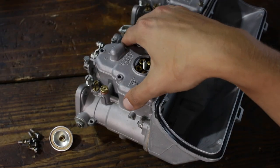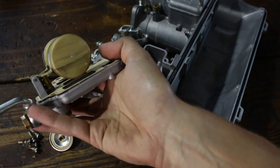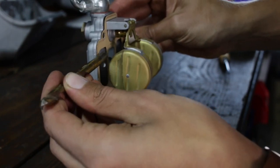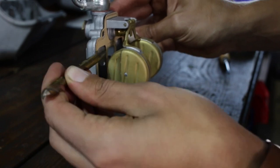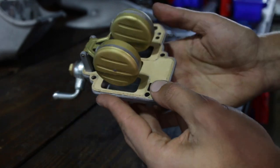The floats on the Duetto are great, but if they're not, the way to move the float level is by adjusting the brass floats within the carburetor. The standard setting for brass floats on Alfa 105s is 8.5mm from the upper face of the carb cover, with 6mm of travel. But it's a good idea to re-measure the actual level within the carburetor once it's assembled.